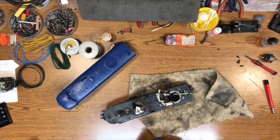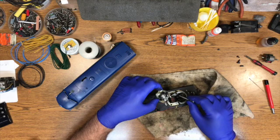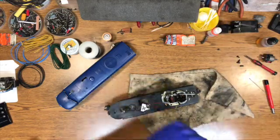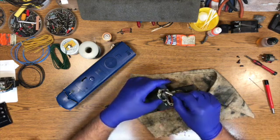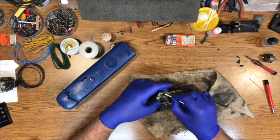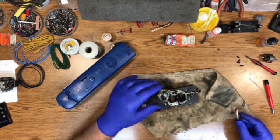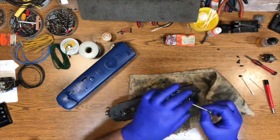Anyway, I'm going to try to get this out as best as we can. Like I said, I don't want to waste our time on screen here of that, so I'm going to take a little bit of an exit for a minute or two and dig this stuff out and get it as clean as possible before we can examine the gears. So I'm going to put a little bit more clean alcohol here on a tip, and the grime and the grease that's on here is terrible. Up in where the brushes go, it's actually pretty caked in there. So I'm going to have to do a little bit of disassembly to get this into some kind of shape where I can do a good examination of what's going on.